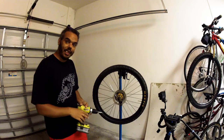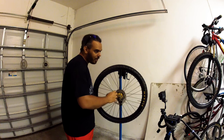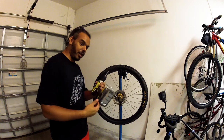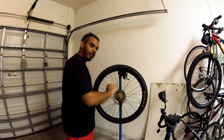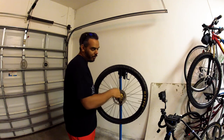And there we go — it's as easy as that. Six bolts off, new rotor on, six bolts on. Thread them by hand, finish it off with a drill or an impact driver, then finally torque it down. I don't have my torque wrench with me tonight, but I will torque these before I ride.